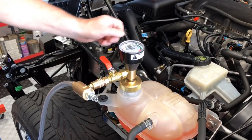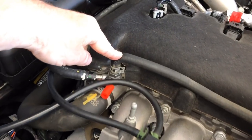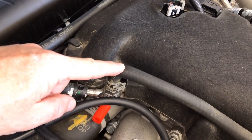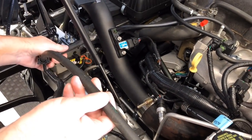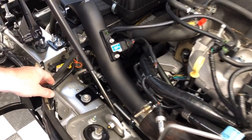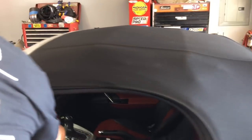I'm doing this in two stages. I first used my brake bleeding tool to draw the last bit of air out of the upper bleed port. Now I've put a clamp on that line to seal it and I'm leaving the line from the top of the side tank on the radiator open, to pull vacuum and draw out any last air trapped in the top portion of the radiator assembly. Now I'm going to fire up the car, let it warm up, draw vacuum, and carry on the process.